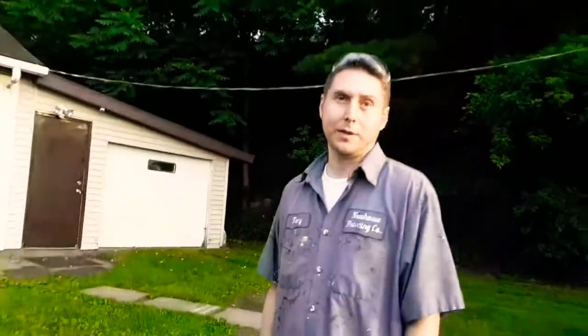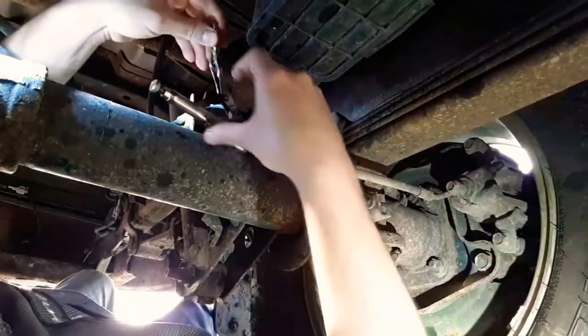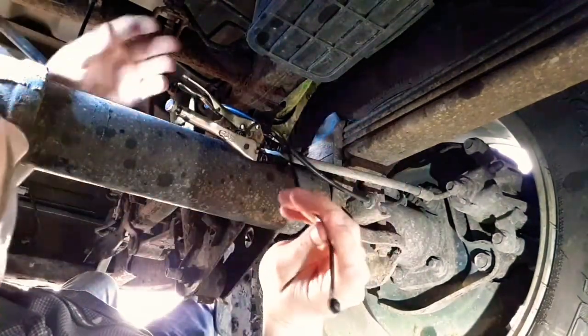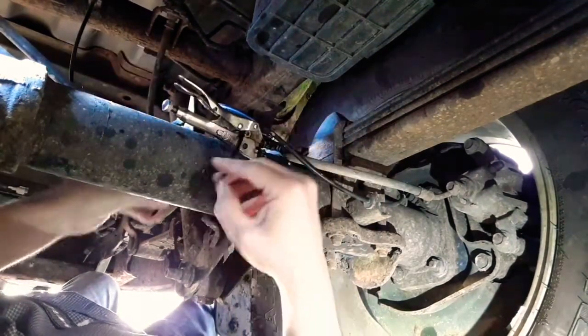Just as a little bit of padding, I put some tape on them because they're brake hoses, they're rubber, and I didn't want them to tear. So I'm gonna crawl under the truck and pinch one of the brake hoses shut and go from there. Here's the brake hose that goes to the driver's side rear caliper. I'm just gonna clamp it shut and zip tie it down to something so it doesn't fall off while I'm trying to drive.